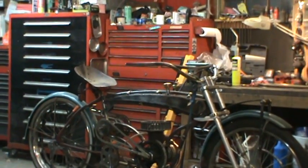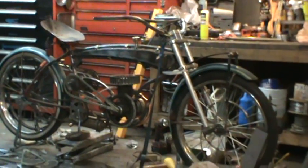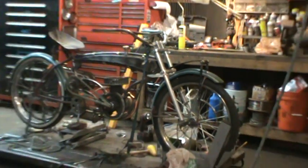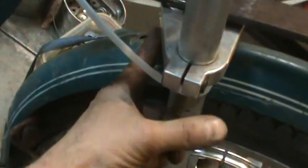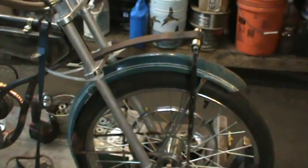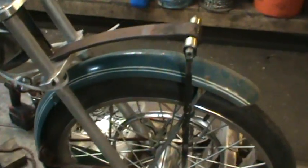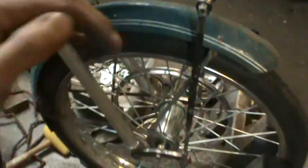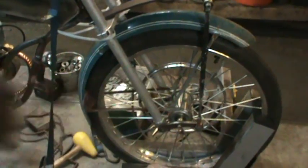Front fender. I think if I slice the fender right in half and then sleeve one side into the other to make it smaller, it'll make it stronger. You know what I mean? So my thought is probably take out a little bit of it, slice that out, slice this out, have one cap over the other one, and I'll adjust the two pieces and see what I like for a window of how big. And then I probably can take the shrinker stretcher, hit it on the stretcher right here, and relax the bend of it. Try to make it a little fatter too.